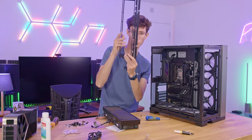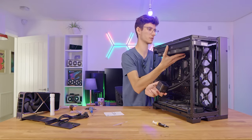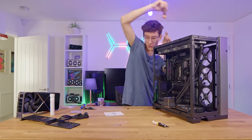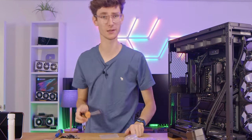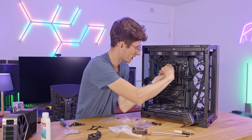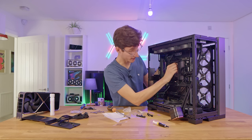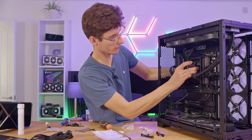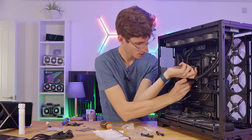If you've got rid of a lot of the thermal paste, just start again and add your own. If you have a better thermal compound, why not use it? Installing the radiator at the top is very straightforward because the bracket also removes. The AM5 mounting means you just screw these replacement posts into the existing backplate — it's worth bearing in mind that AM4 coolers aren't compatible with AM5 unless they don't need a separate backplate. Grab our cooler and it goes over those holes and secures with four posts. Very very straightforward.